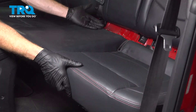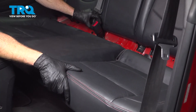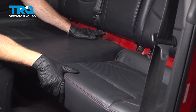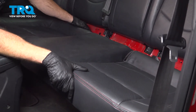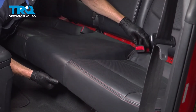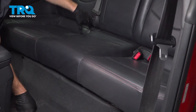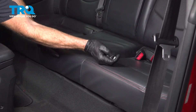Now it's time for the rear seat. As we start bringing this in, the most important thing is your seatbelt buckles — you always need to have access to those, so make sure they're in the upright position and they will make their way through the slots in the back seat. You're going to have three buckles: two on the driver's side and one on the passenger side. There were also mounting bolts that held this in place — you can see one of the ports right here and the same on the other side. Lift up on those buckles, make sure they're not twisted, press this back as far as possible, then press down on the front locking it in, and continue on with the two mounting bolts holding it in place along the backside.